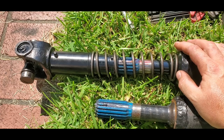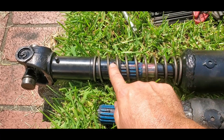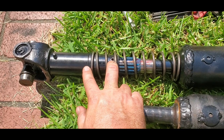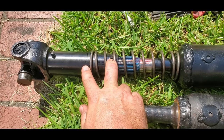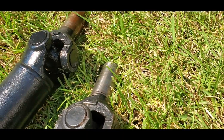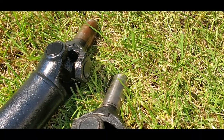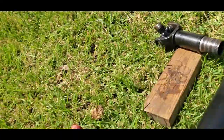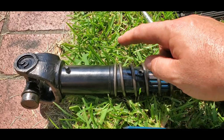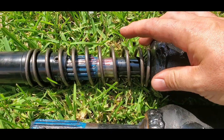Come to find out I needed about three and three-quarter inches worth of slip. They've got a set screw in here, and what that means is there is a bit of yoke inside of here. I figured that would be enough — enough of the spline in there to support this. Just like on the driveshaft side, you can only come out so far before it starts creating vibrations. I want to say it has to have about an inch inside of the tail shaft of the transmission. So you figure that this being staked in there, they would have put the allowed amount in there to not have any vibrations.